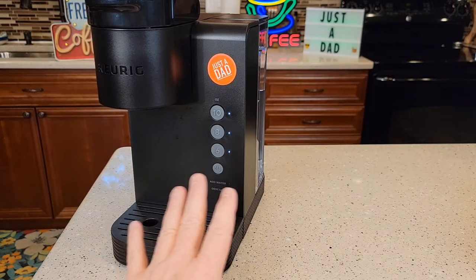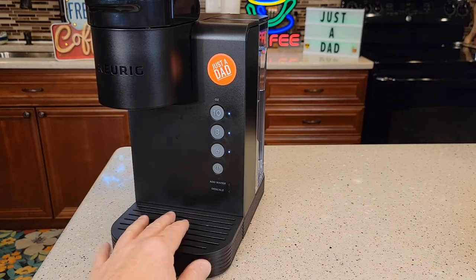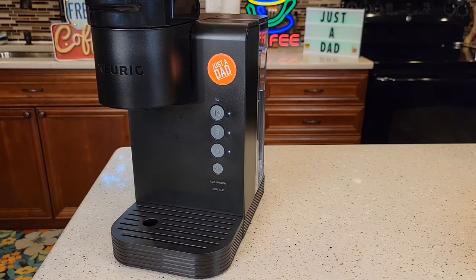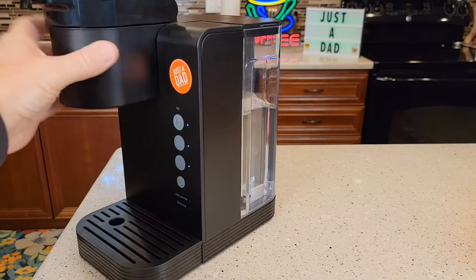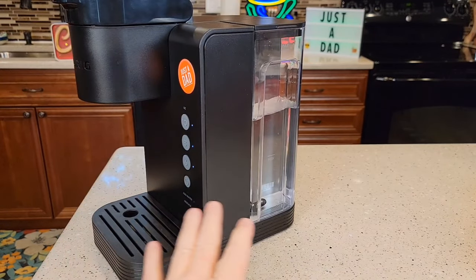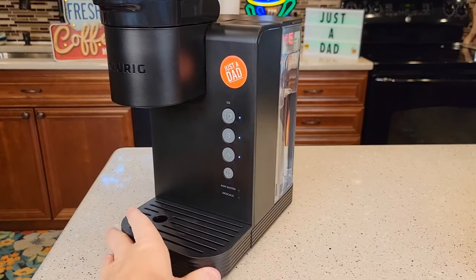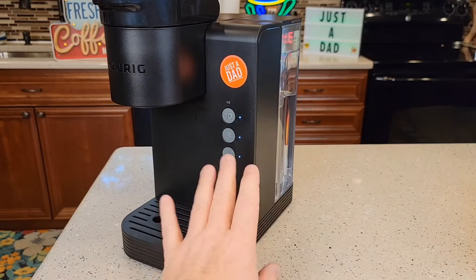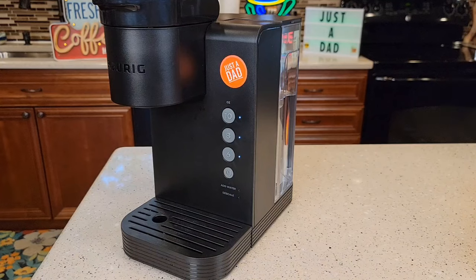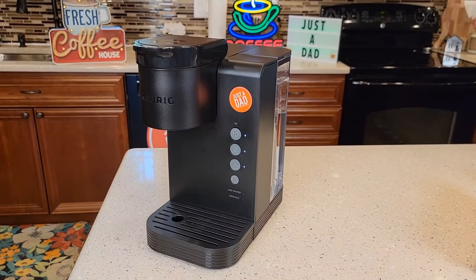When I did mine, it didn't work the first time and I had to unplug it and start all over again, but eventually it did work. As long as that add water light comes on during the process, you will get your descale light to go out. Sometimes just during normal brewing, if you run your tank dry, that could also cause it to trip. I do have a detailed procedure on how to put it into descale mode and how to descale with vinegar and the Keurig solution. I hope this video helped fix your Keurig — if you could please like and subscribe.